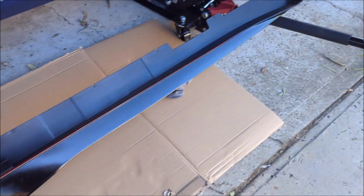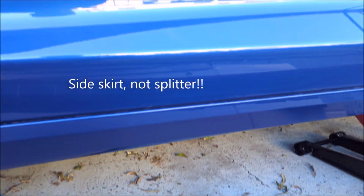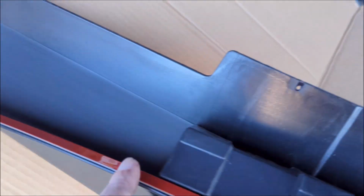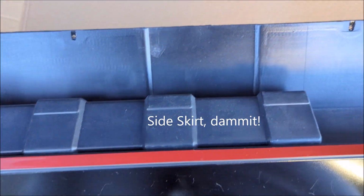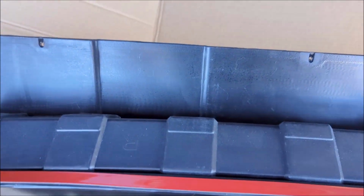Okay, I've got the wheels off. I've got my splitter spray painted, ready to go into place. Now, just looking at this setup, it actually comes with a strengthening rib that you insert into the back of the splitter, which gives it a bit more strength when you fit it up, so this doesn't want to collapse at all, which is a good idea.